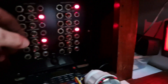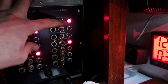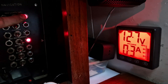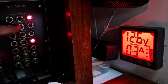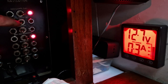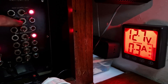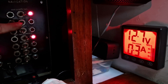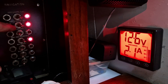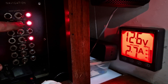Most of what I've got on at the minute is low power LED stuff. My nav lights — sail nav lights at the top — I've just switched them on; they're LEDs. But if you look at the amps when I turn on the engine nav lights — the deck lights and the steaming light — the steaming light is LED, but the deck lights port and starboard and the stern light on the rail are all filament lamps. I'll just flick that on and you'll see how much difference there is — it's like 2.6 amps. That's insane. I'm definitely changing them out for LEDs.